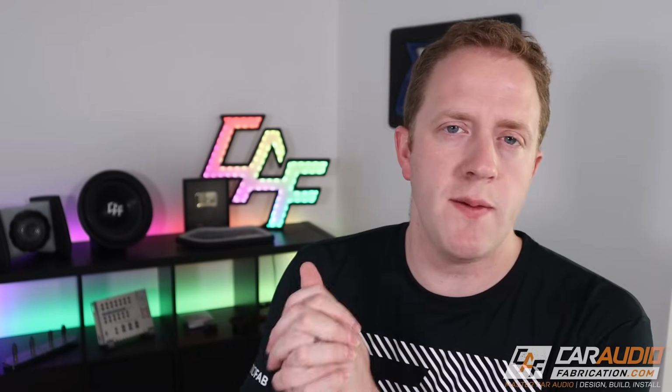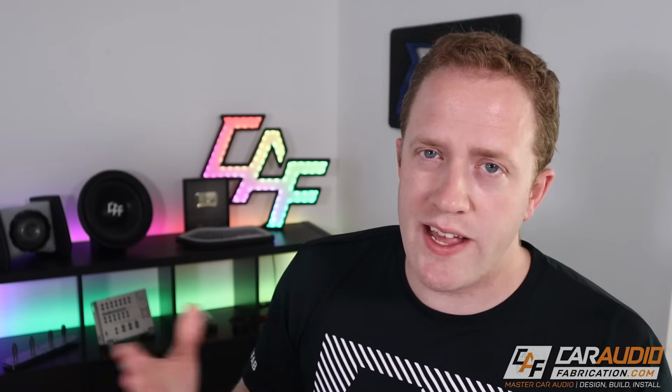If you're still having a noise issue after trying all the things in this video, something else you can consider is a ground loop isolator that is made to go in the RCA signal wire path to the amplifier. Again, to check those out, don't forget I have a couple of helpful links down below.